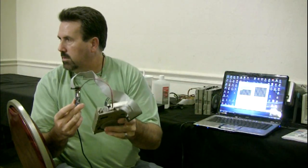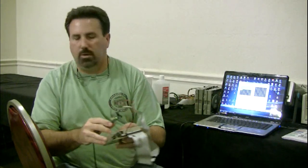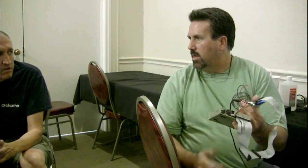Audience: What about the 5.25-inch drives? You have to have an external power supply because they need 12 volts. But all these original 3.5-inch drives are 5 volts — no big deal to run them off USB. They run about 250 to 300 milliamps of current, and USB is typically up to 500. The USB spec is programmed for 500 milliamps, so your port will notify you if this device needs more power.